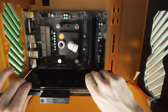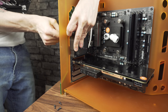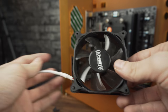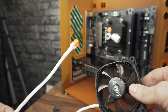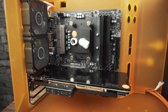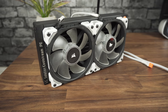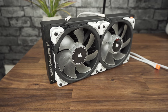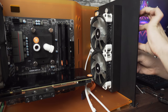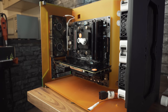Now all that's left is to pop the GPU in place and add the rest of the parts. Let's add the 80mm fans to the back of the case — I used Noise Blockers on which I added a dust filter and sleeved the wires. I also changed the 4-pin socket to an orange one. For my radiators I will use two EK 240mm PE units with 120mm Corsair ML fans. I'll add the radiator to the right side now, and the top one I will add later.